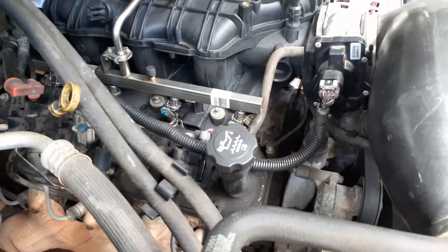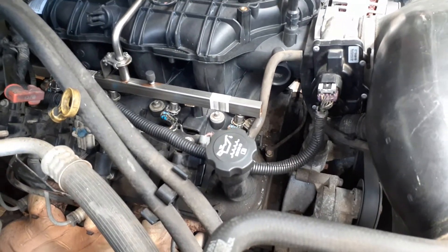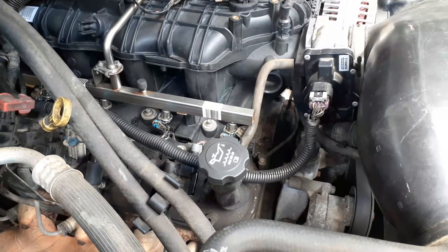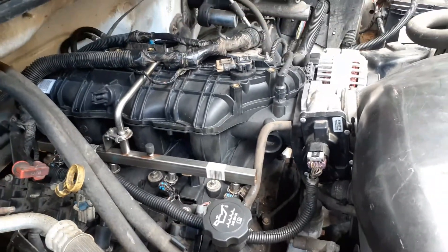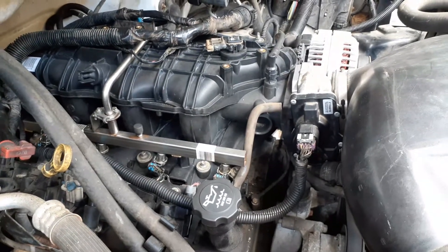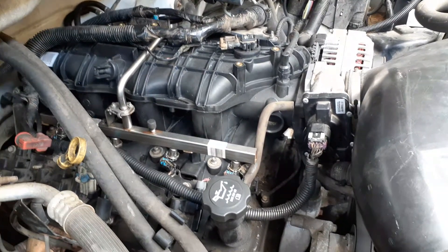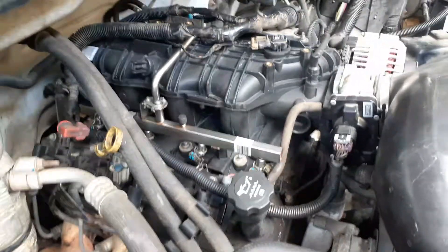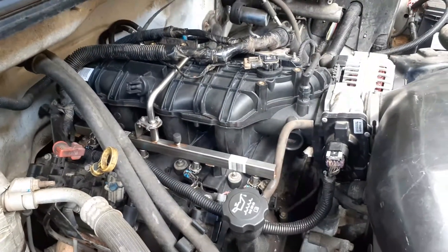Something's going on with the wiring from the ECM to the data port — it keeps erasing the tune but won't write back. I had to build a bench harness and was able to reflash it and get a file in it, so hopefully I can figure out what that is so I can get some data logs and get my air-fuel dialed in before we get to the turbo.